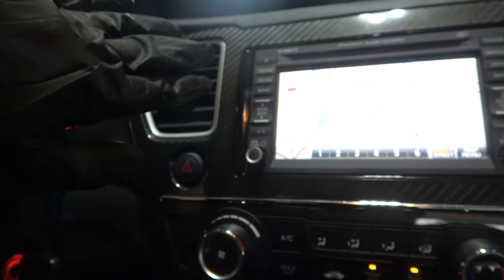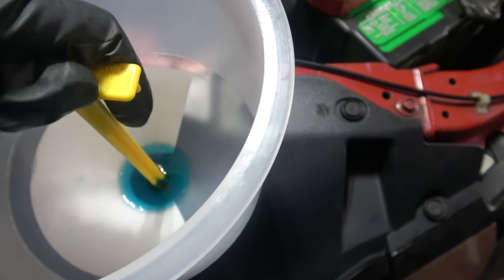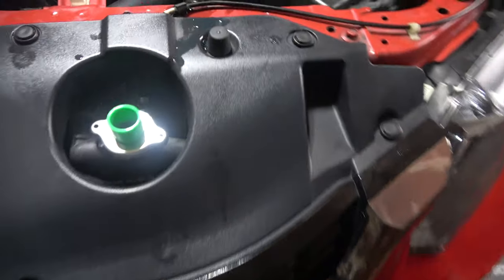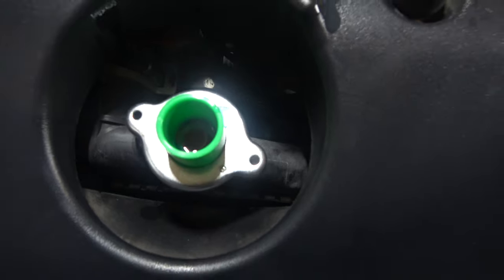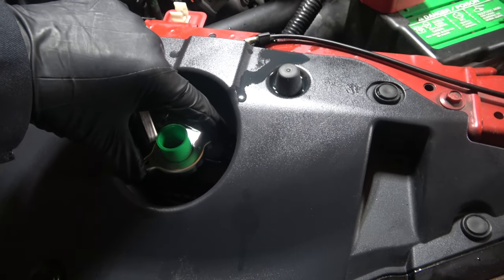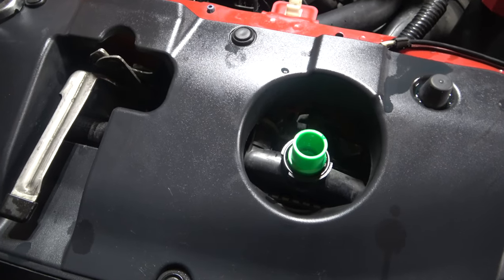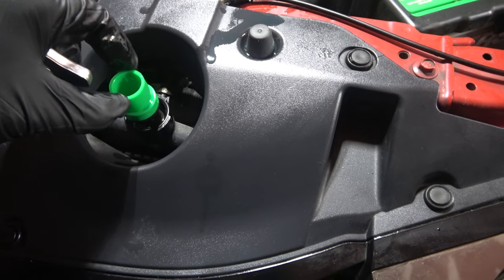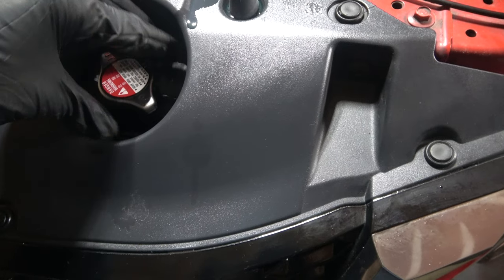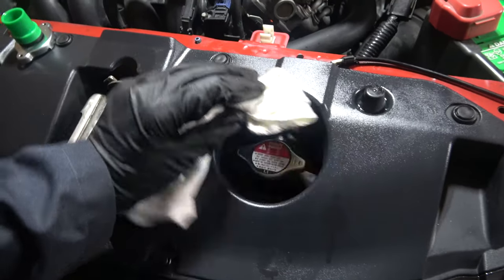Come inside the vehicle and turn it off. Then use the plug — push it down into the burping tool, and it'll allow you to lift it off without getting fluid everywhere. It's still a little messy, but much better than not having a burping tool. It does plug the fluid. Remove the metal cap and the green seal. You should have got most of the air out of the radiator, so put the cap on, tighten it, and clean as you go. As a final step, get back in the car and look at the dashboard to make sure you don't see any warning lights for your coolant — they may be blue or red, and you shouldn't see any. And you're done.